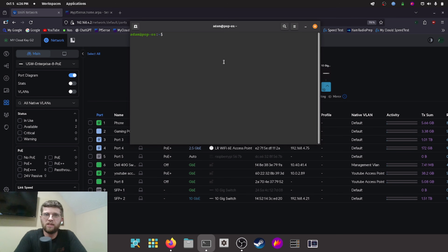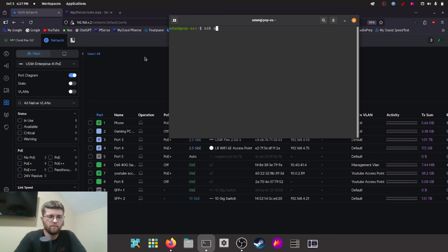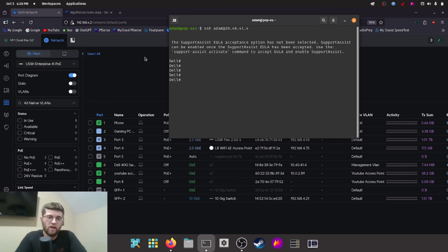We'll go ahead and SSH in — SSH with my user Adam at the IP address. Right now we're in the enabled part, that's why you have the number sign there. If you type CONF you'll get into config mode where you can configure the port. I need to configure port two to be on and on VLAN 1, which is my main network VLAN, so my PC's 40 gig connection will come up. By default all the ports on that switch are turned off, I guess for security, but we'll go ahead and turn on port two.